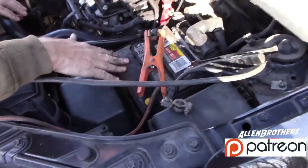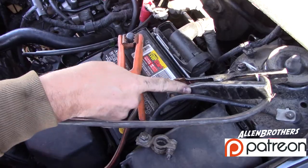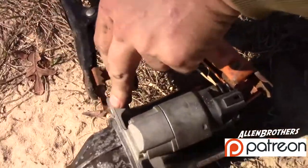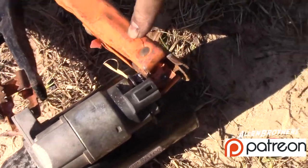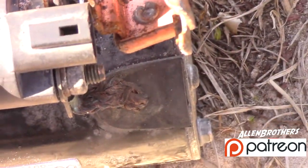Disconnected all the batteries — it's no longer hooked up in any way to the car. Negative and positive are hooked up down here. You take your negative and just put it on the body of the starter, and the positive side is hooked up to the solenoid where the cable normally is, and you just want to make the connection between here.